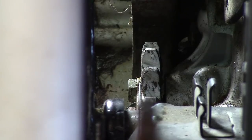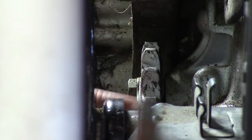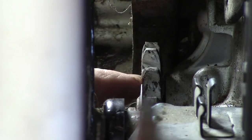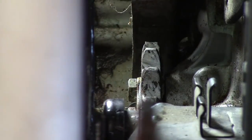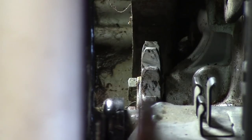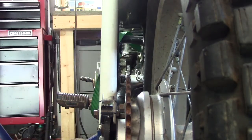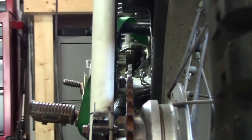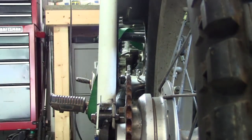What you're seeing right there is the front sprocket. I painted it white on the face so you can see it. I've got a wire running parallel to the sprocket going all the way back to the rear sprocket, and I've aligned the rear wheel to that front sprocket. You can see when I zoom in, they're lined right up nice and parallel.